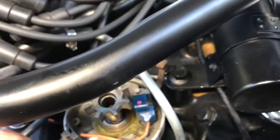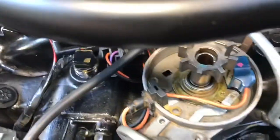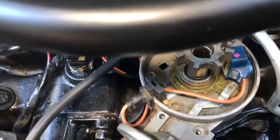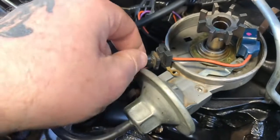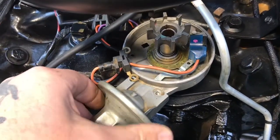The mechanical advance mechanism was sitting over that dowel just like that, and there's a little C-clip right there that was on the dowel. You pull that little C-clip off, then pull your rubber piece up and out. There's one screw right there that holds it down, and another screw behind it. Pull the vacuum advance out by pulling the arm up.